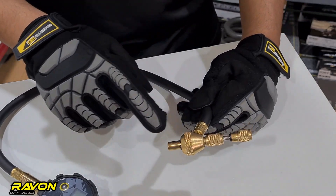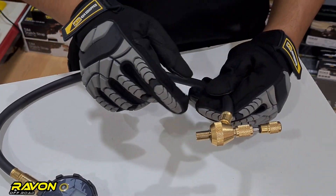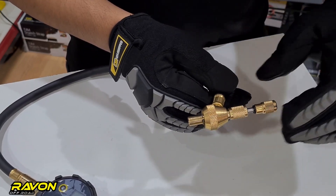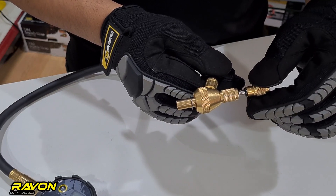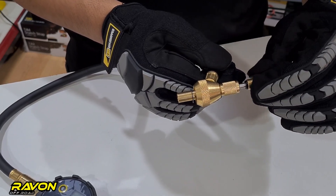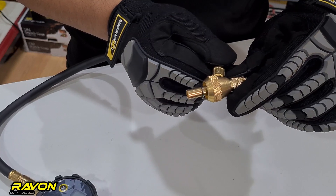The chuck has different parts: the nozzle with a mid connector, the steel rod, and the slide valve. What you do is use the mid connector and thread on the nozzle to your tire valve. Then you remove the valve core safely by using the valve rod. And to release tire pressure, you just slide the slide valve back out.